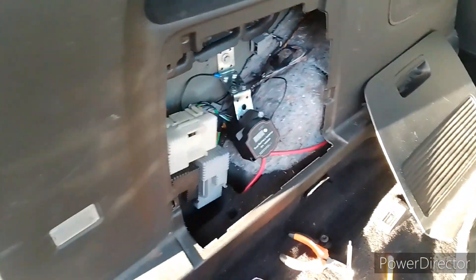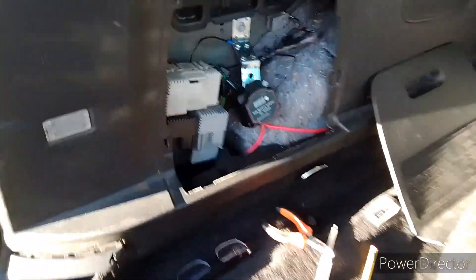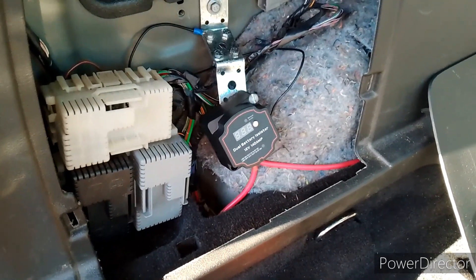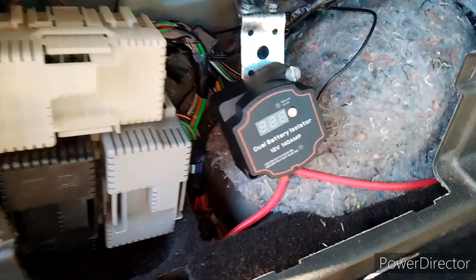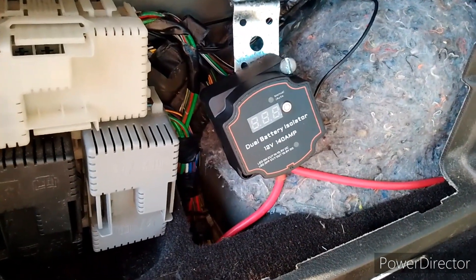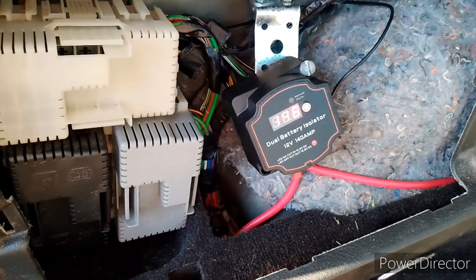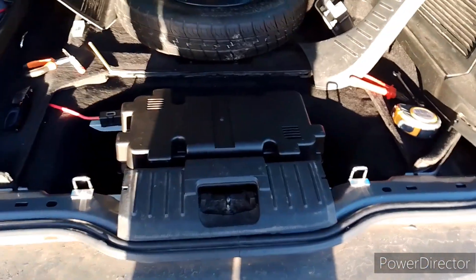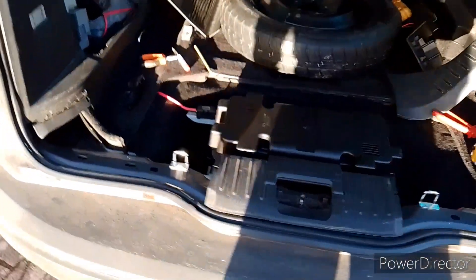From there we'll take it to the various switches for the lighting circuits. If I just get my assistant to start the engine, you'll see the switch come on — switch it on please, Rach, switch the radio off, thank you. So when the voltage comes up — there we go, that's now kicked in — that's now charging the leisure battery.